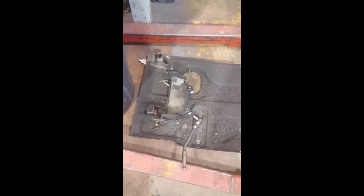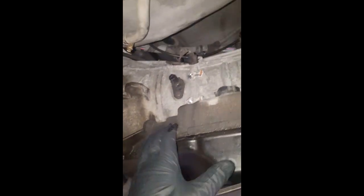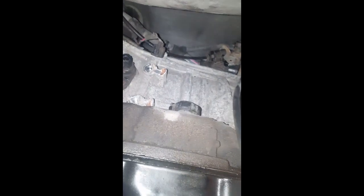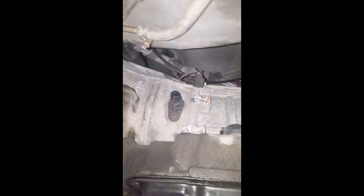Remove the starter bolts — starter's loose now. Take these bolts out of the bell housing. Now you can see the torque converter bolts and brackets back there. I have this on the transmission jack and it is tilted pretty hard, but you have to be careful not to tilt it too hard because the plastic intake will hit the firewall and you'll break the intake. The last bell housing bolt is back there — the starter's in the way, so after the starter's out of the way you can get that bolt out. Get your torque converter bolts out and I think I'm ready to pull this thing out.